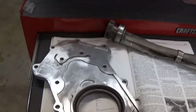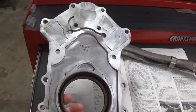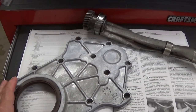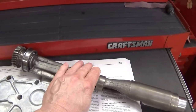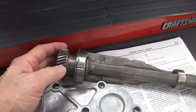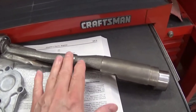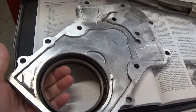You can see this part is clean — I've already put the seal in it. I did a fine wire brush on the backside to make sure the gasket surface was clean and ready for new gaskets. The Super Clean washed off that brown haze that even the kerosene wasn't removing. This is the counter balancer shaft after soaking in the parts bath with the kerosene and mineral spirit mixture. You can see the gear — how nice it came out, looks like a new one. I just sprayed Super Clean right on it, washed it off with water, and it looked just like this — brand new, like it had been boiled or something.